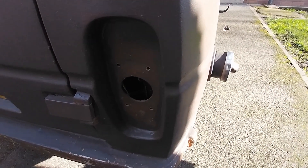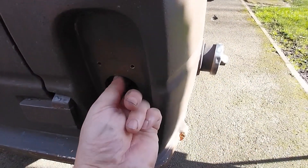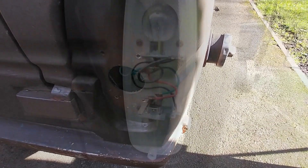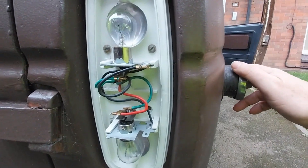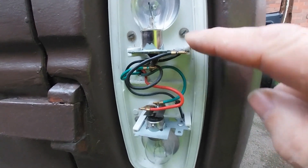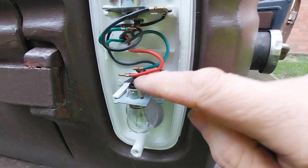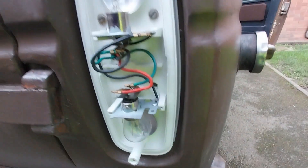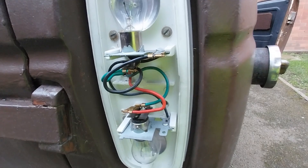The rear lights have been removed and I've painted inside here because when I painted before I just went round the outside and didn't get in properly. The wires are in there - they just want trimming and fitting to the brand new lights. That's one new light fitting installed. You have to put a lot of pressure on the screwdriver on these little fittings because the original roll-plug type thing just starts to turn, and you have to press it against the plastic to get the screw to turn without it all spinning. I'm not really impressed with how you just have to feed the wiring and crimp it, but they are meant to be trailer lamps - just not as good as the old fashioned lights from 60s and 70s cars. I've checked that they work, so I'll get a lens on and get the other side done.